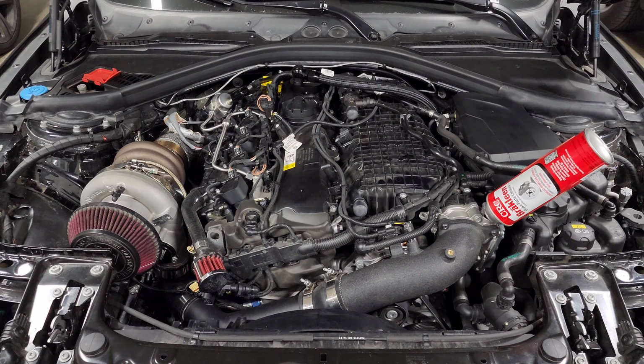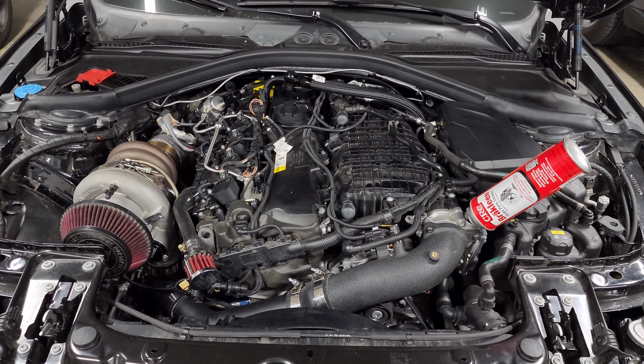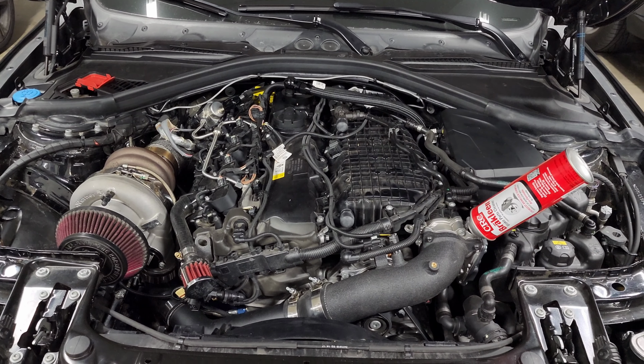Now, they do sell a lot of different options like slotted and drilled. Most times, most people just recommend sticking with blanks if they're available because that gives you the most actual surface area for your pads.